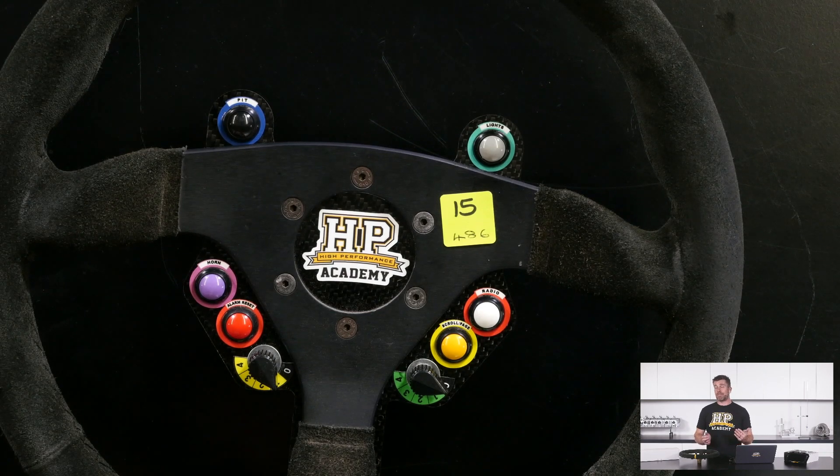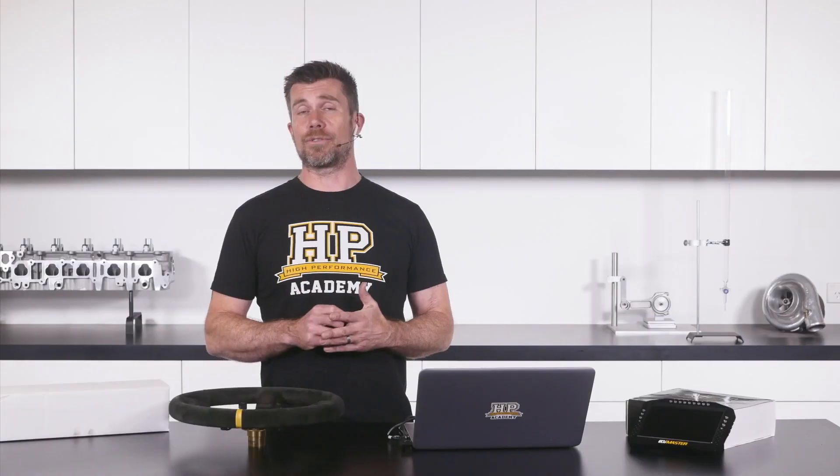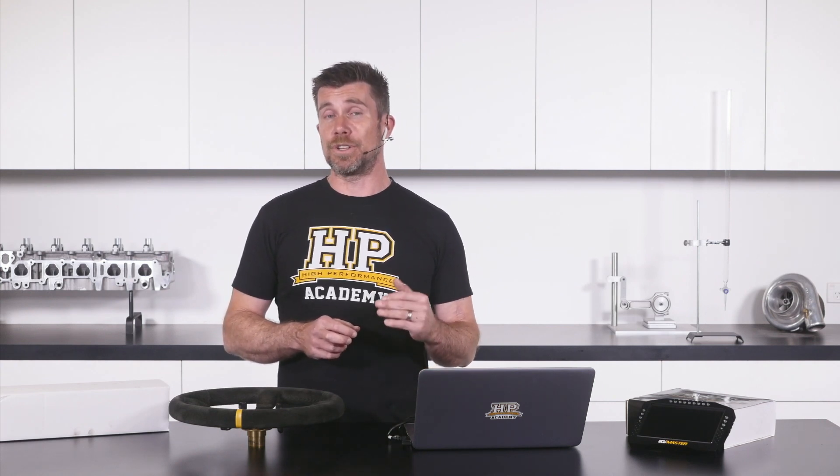We are only doing a one hour endurance race but we're running the factory 50 litre fuel tank in our Toyota 86. Unfortunately 50 litres and one hour of racing don't go well together when we've got a 450 horsepower V8. So it's pretty important for us to monitor the fuel used. That's all calculated via the MoTeC M150 ECU — it sends the fuel used data through to the dash and based on the fuel in the tank and that fuel used, it can calculate the fuel remaining.